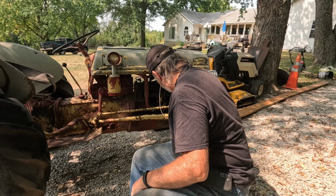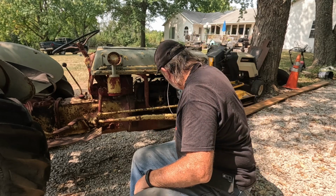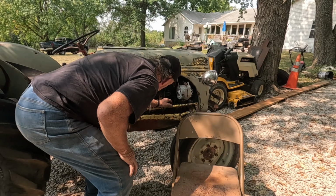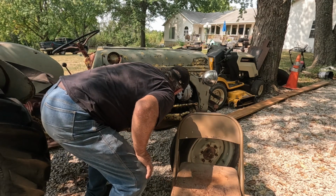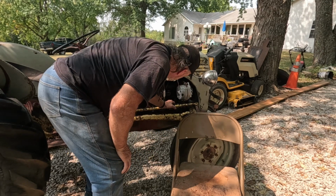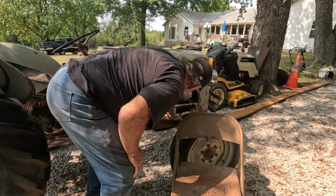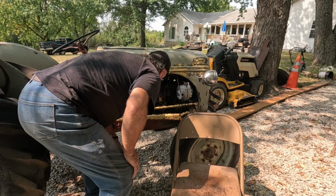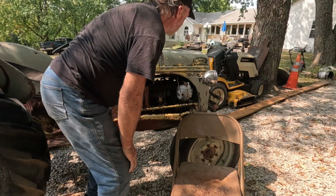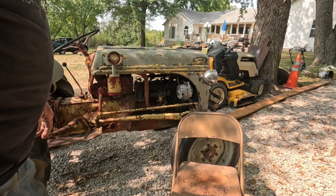Yeah, get a hose clamp. Does look like I got a little bit of a leak right here at the front. I just noticed, but I got a feeling that's oil leaking around the gasket for the governor, because that feels and looks like engine oil. So probably get a wrench and tighten that up, but I may have to pull that apart and put a new gasket on it. But overall, I can't complain. I'll come back when we get ready to redo this wiring.